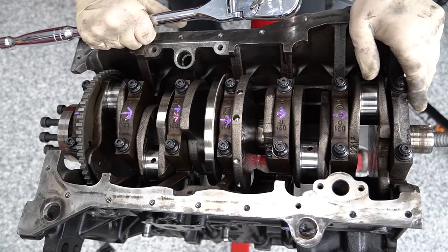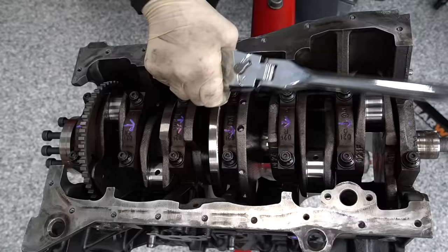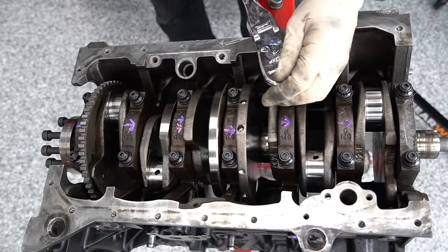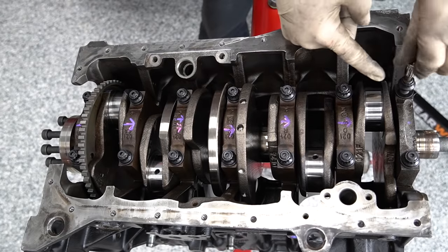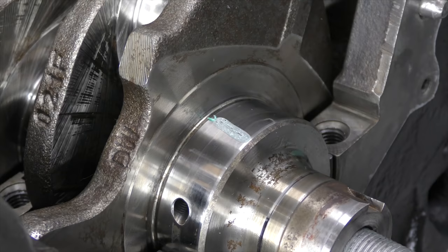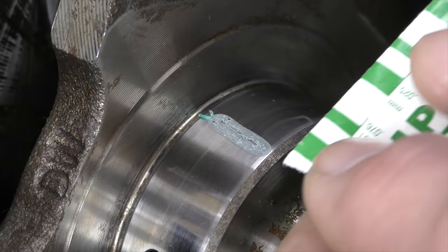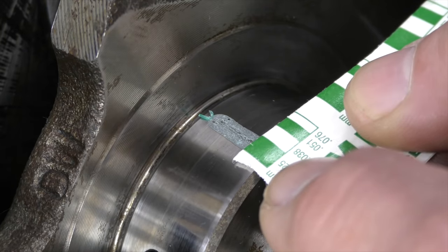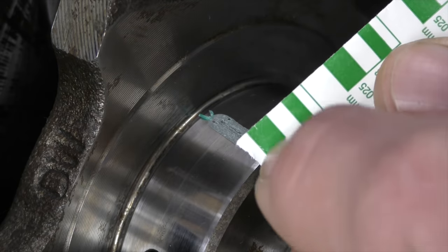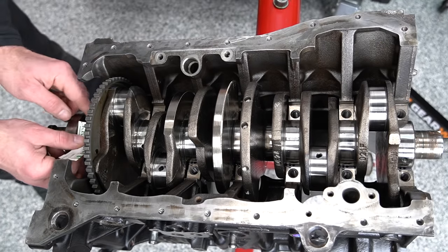Everybody's torqued. The most frustrating part is that the second after you tighten that last bolt, it's time to loosen them up so we can check our oil clearances. We'll slowly loosen all the main caps in reverse order, starting from the outside and working in. I'm going to keep the bolts with the mains I tightened them down with for consistency. On the very first crank journal, you can see the wax from the Plasti-Gage smooshed in. Holding up the measurer, it's just a little bit smaller than the 0.025mm green mark — pretty good and within spec. We'll check all of them to make sure none are outstanding.